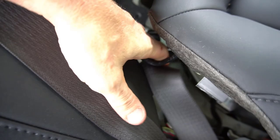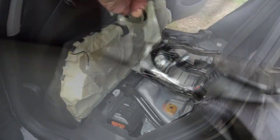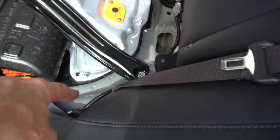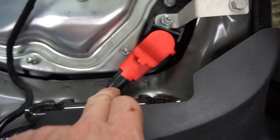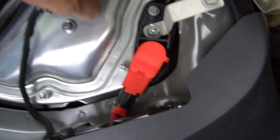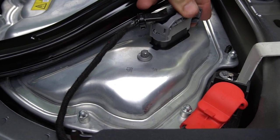Alright, what's connected here? Oh, we got a little connector to unplug. How does this unplug? Wow. So yeah, there's two connectors. There's one over there. And there's one here. This little guy here. This is the 12 volt connection. Yeah, they got a ground for that. 12 volt onto the battery and everything. And then supposedly, when you disconnect this guy, I forget how this interlock works.